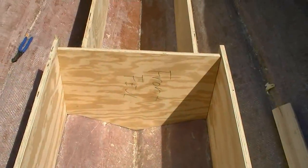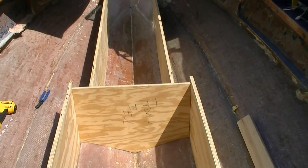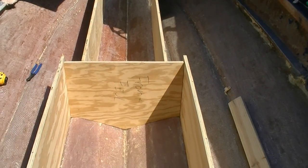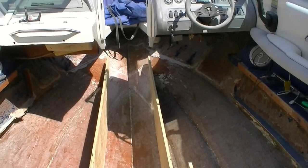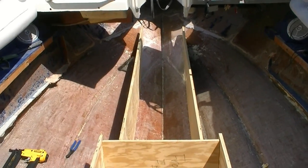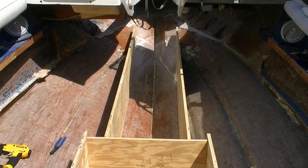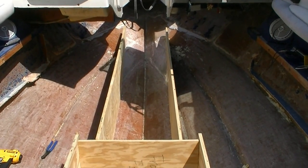I've labeled everything. I've got front fuel, aft fuel, everything starboard and port. I did it in Sharpie so you can see it after you put the fiberglass and waterproofing down on it — pull it out, waterproof it, and grind that down up in the front so it's all prepped and ready. And then grind my keel where it's thin so we can put some more in there. I'm going to go get some 24-ounce woven, which is a lot heavier duty. I'm going to put a couple of pieces down there and then finish it off with 1708 to make it a nice, good repair.